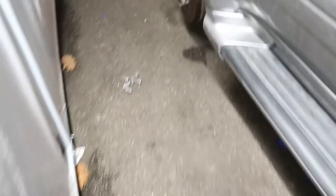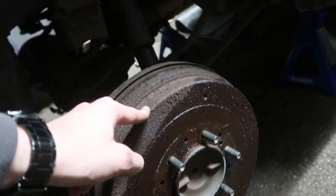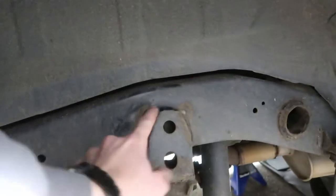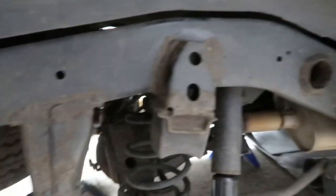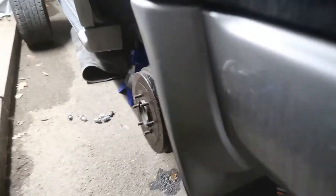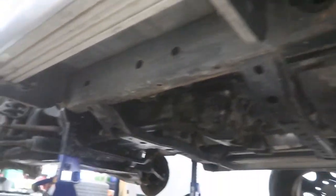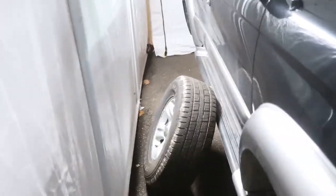We beat the rear wheels off with a mallet — they were being a pain. As you can see, these are sanded down and will need to be painted or replaced. The frame looks pretty good though; just your typical 20-year-old wear. I'll probably pull the hitch off to make sure the mounting surfaces are okay. We're going to be doing different springs and shocks. There's definitely some surface rust but it's 20 years old — can't really complain. Plenty of good material to work with here.